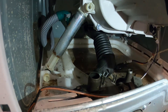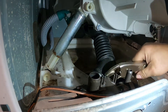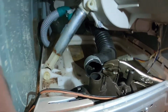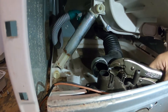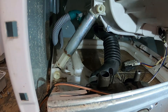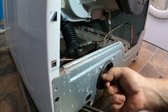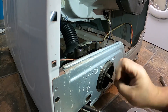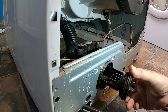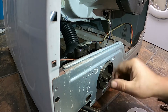Inside, we also have the hose for the drum to take off. So we'll just take off the clamps on that one — that just pops off. You can see that clamp just comes off there. And we've got two screws left here and here. This is the filter, just so you know — I'll take that out so you can see what that is. This is the filter that you would regularly maintain. There's a little bit of debris in there still, so we'll clean that out after. That's what that is. Let's put that back in there.